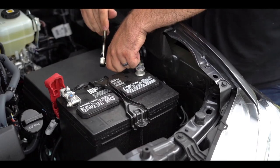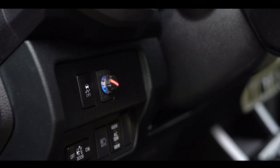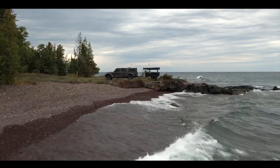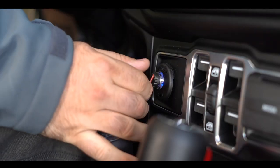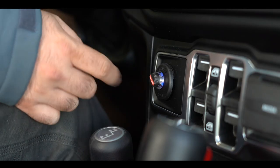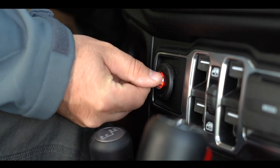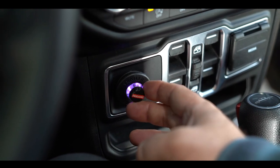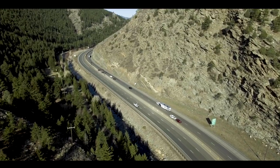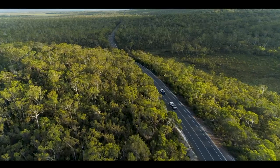Reconnect the battery. Turn on your vehicle, press in the dial and see if you have power. Now that power is established, let's switch between braking modes. To change between braking modes you must have a trailer connected and be at a complete stop. Rotate the dial all the way to zero, release the brake and then apply the brakes, then double tap the knob. You will see the LED change from blue in proportional mode to green for user control mode or vice versa. Over the course of regular driving and braking, the trailer brake will calibrate in the orientation that it was mounted. The only time you need to recalibrate is if you move the positioning or the location of the brake controller.